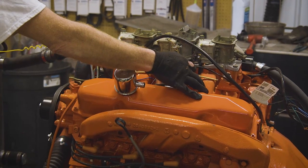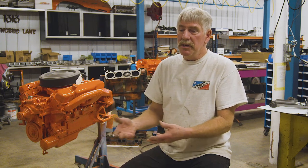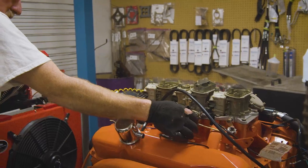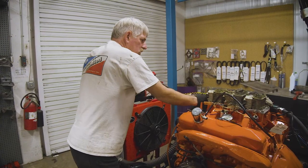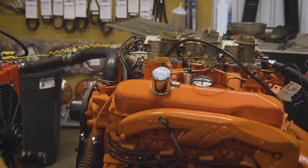At one point I was getting a little concerned because it was not firing at all. Why is it not firing? Everything's set up, everything's going. Had plenty of fuel, I know it had spark, but it wouldn't fire. First thing that happened is we found out we had two different size fuel lines — one from the engine to the remote fuel tank. So when we initially tried to start cranking the engine over, we had a nice fuel leak. And then there were some on the carburetors also that apparently didn't get completely tightened down. So we took care of all the fuel lines, got them all tightened down. Just kept cranking on it, and eventually it leaned out and fired right up and ran good.